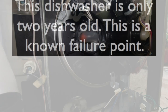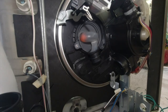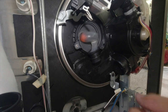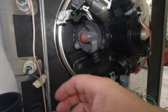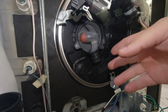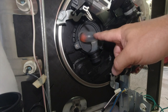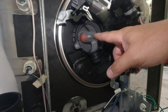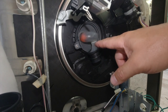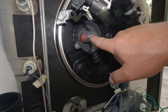Today in the shop we're going to talk about this dishwasher I'm working on. There was a leak underneath the dishwasher while it was running, while the agitator was actually running. What we diagnosed it to was this particular component — this is a GE dishwasher and the component diagnosed as the issue is the diverter valve.